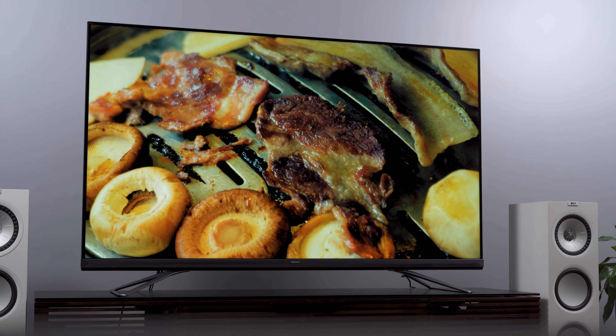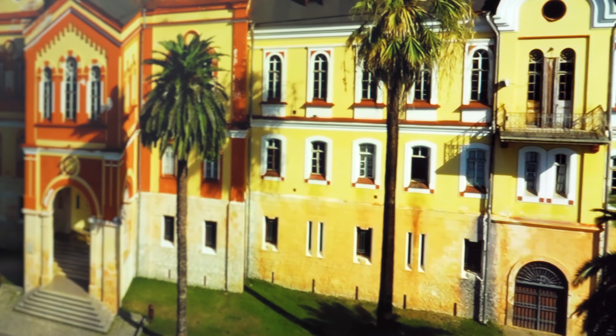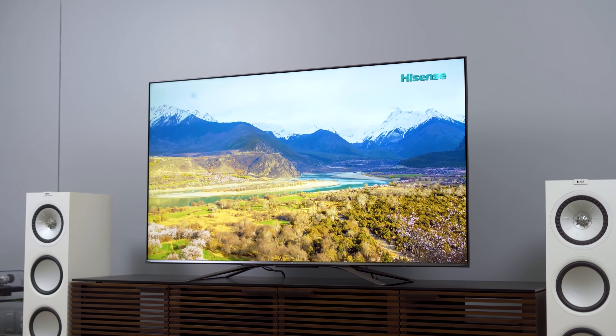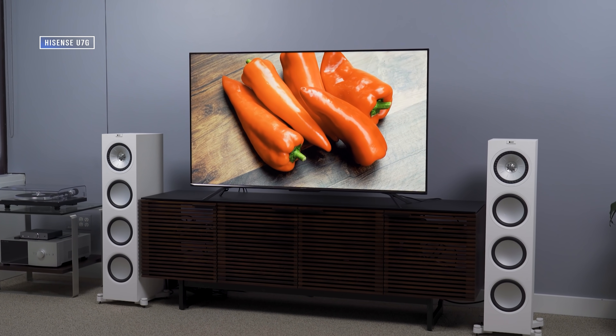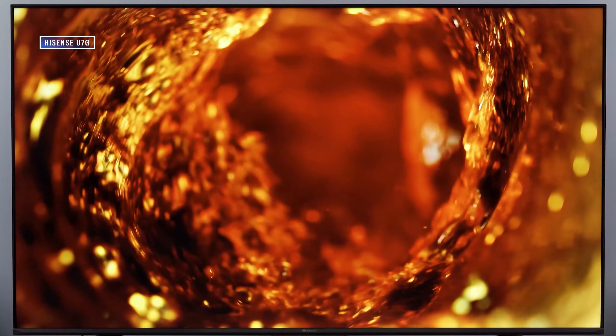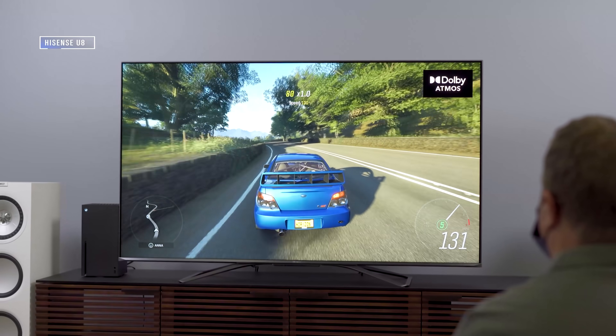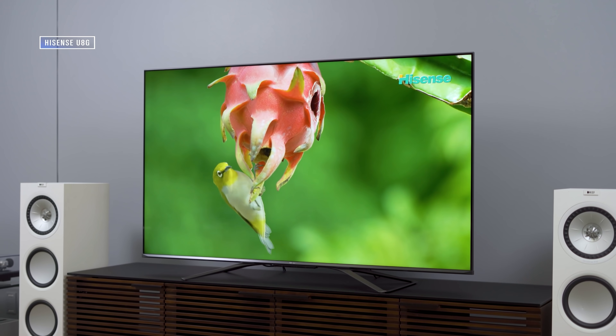For those not already tuned into what dual cell refers to, here's a quick rundown on the technology. In most LCD TVs today, you have an array of backlights at the back of the TV, and these lights are dimmed and brightened according to what's happening on the screen. Those lights can be further broken down into zones, so you can dim some lights in one zone and brighten lights in another — this way a spelunker's flashlight can be bright while the cave in which they are spelunking remains mostly dark.